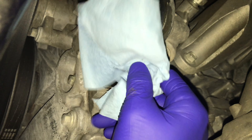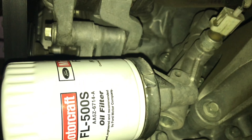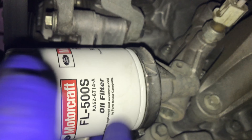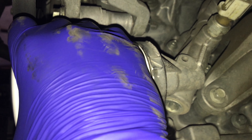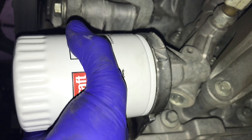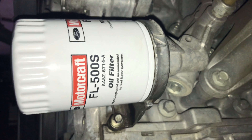Don't open it much more than that — it's draining pretty good now. Let that stop, then take your oil filter off. Keep turning left. Now be careful when you take it off because there's probably still oil in it. Don't do this when your car is super hot — you're gonna burn yourself. More oil is gonna come out, so pull that out. Let it drip for a bit. Put some shop towels there. Tighten it until it's tight but don't over-tighten it. Give it about a quarter of a turn with the oil filter remover and that's it for the oil filter.